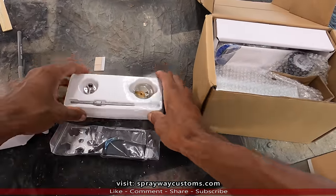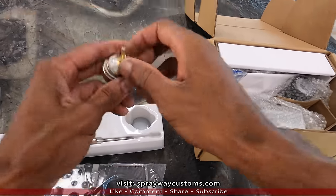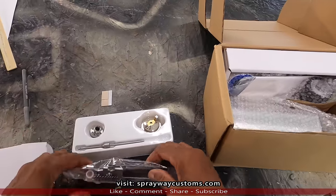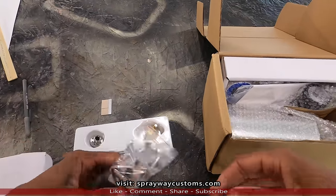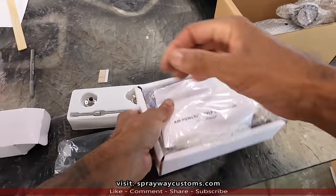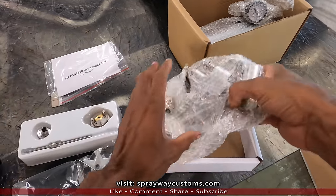The nozzle and the tip. I'm not sure what size tip it is. It's a 1.7 tip. It's the tool set. Here's the spray gun.